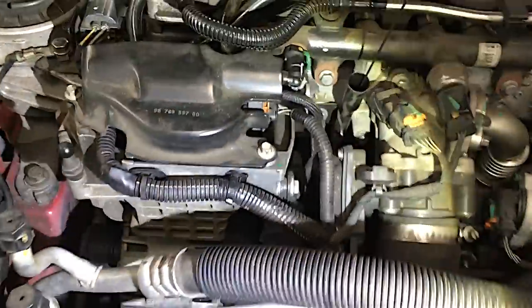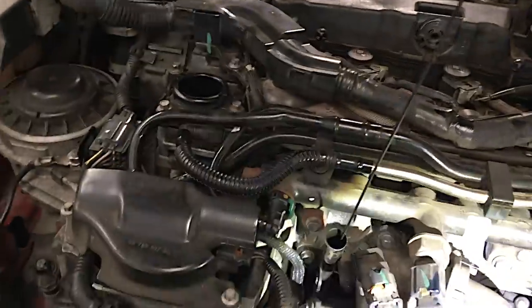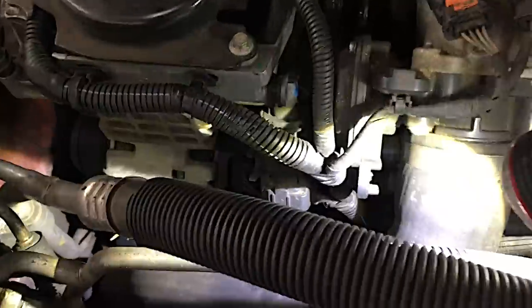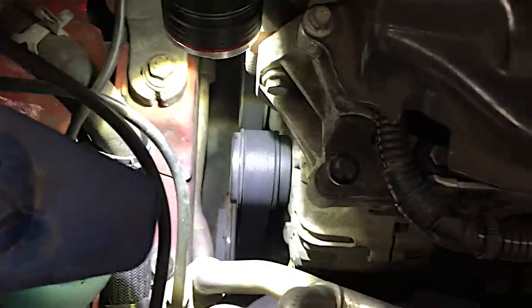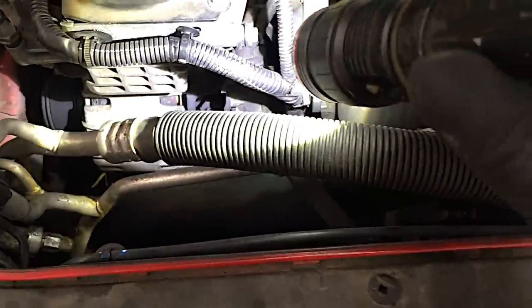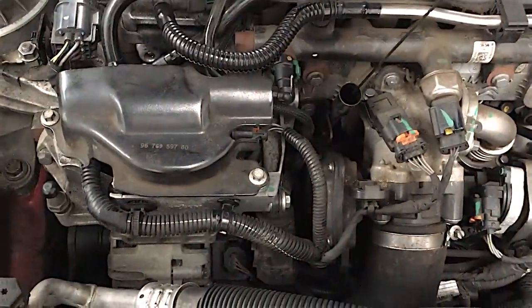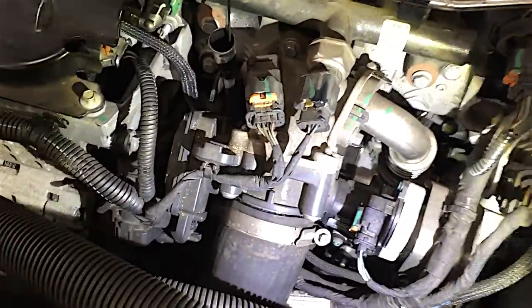So anyway, we're ready to change the engine oil. The fuel filter we would replace. Check your turbo hoses are okay, because they can get split. And once again, what I've just said about that alternator belt flapping around, sometimes they can hit the lower turbo hose and cut a hole in it. Then you will have problems, because if the engine gets choked up, the exhaust will get choked up then, and you'll end up having to do a static regen on your car.